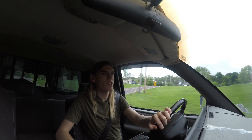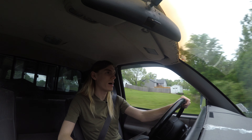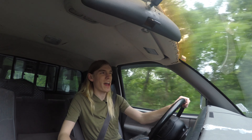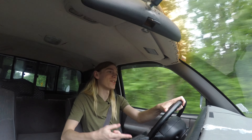I drove it to New York City last year to help a friend move. Everything went perfectly fine except the relay for my turn signals decided to die — it didn't really die, but it started flashing fast and then real slow, just really random. I fixed it by switching the flasher relay with the turn signal relay, because there are two different relays. Now the flashers flash at random speeds, but the turn signals don't, so I fixed it.